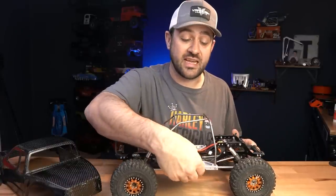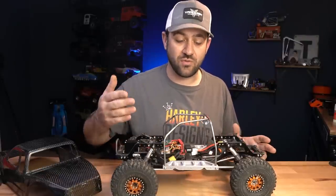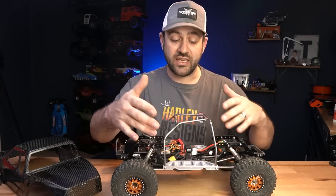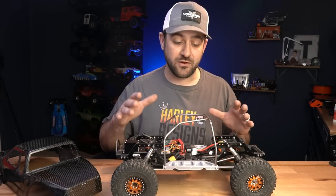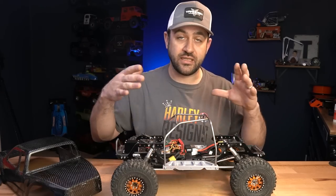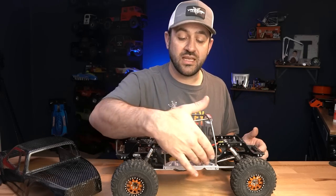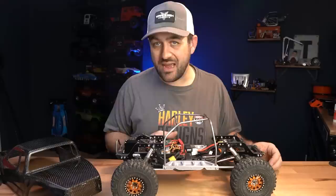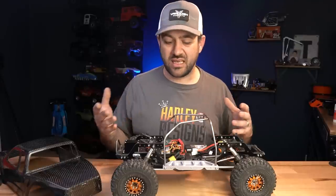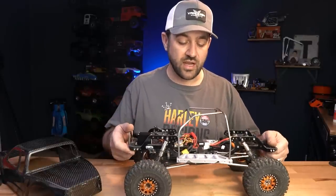This is not the final design of the slider — it was mainly done for these capture points on the roll cage. Now that I've got the height and positioning of the cage determined and confirmed, I'm going to design up some plates that will connect the roll cage segments to each other and provide some mounting points. I'll tie that back into a more slimmed-down slider mount, which will make things cleaner and more rigid and give me a benefit of being able to do a number of additional things later.